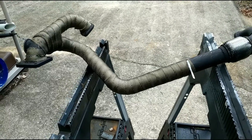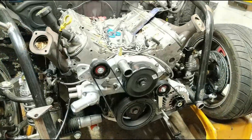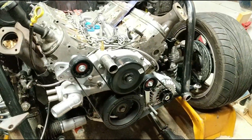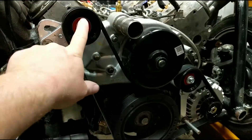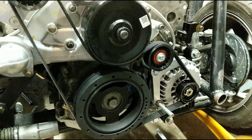Going to dig out the turbo and get it back on for real this time. Hopefully I got the bolts I need. One thing before I put the exhaust in — I do have to finalize the ICT low mount alternator setup here. I want to pull these back off and make sure I torque these to the right spec, which I'm not sure if I got the one behind the pulley. So I could take this off quick, re-torque it, get my grinder out, and cut that guy off so it looks a little better.